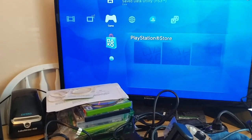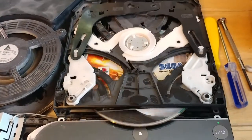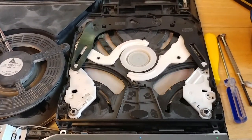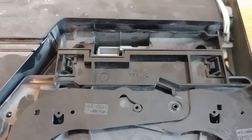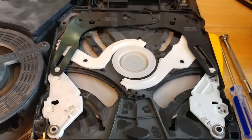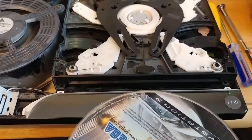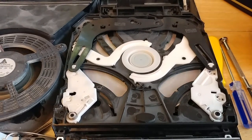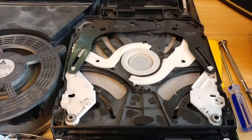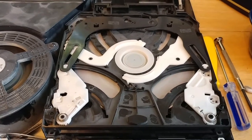I've got autoplay turned off, just so I don't have to keep going, but I have to wait for it to actually show the disc before I can eject it. You guys may already know that or not. Let me put it back in again. Yes, look at that — it's working just fine now. Maybe that was the problem the whole time: those little clips just weren't in all the way. I doubt it though — this machine had not been opened before I opened it and it was having this issue. Maybe somebody just dropped it and jarred them loose.